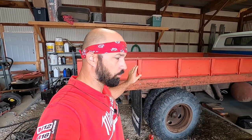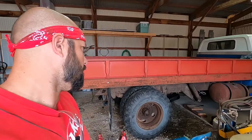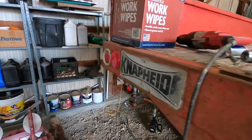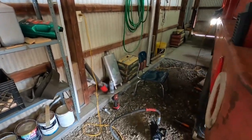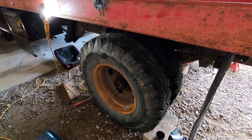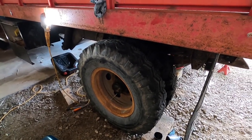We're gonna try this one last time, hopefully. We're gonna be taking off the driver's side of the rear wheels' drum, get all that off, move one of the wheel cylinders, drill the hole a little bit bigger so that we can fit the line nut through the hole in the backing plate. So we're gonna be diving into this, and hopefully I'll be able to get a better angle. I'm here by myself today, at least at this minute. So hopefully we'll be able to get you guys set up, get some better angles, and you can see the entire process of taking stuff off.